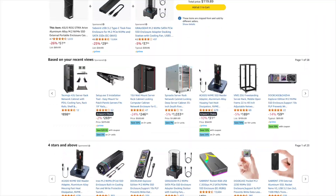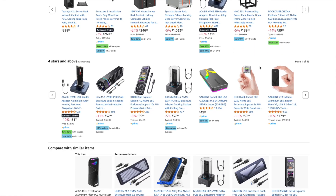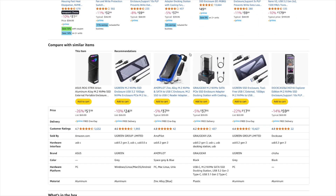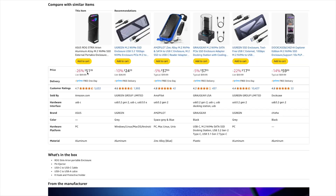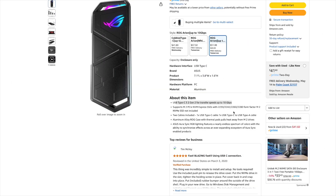You'll see looking at my Amazon that there are a lot of recommendations for NVMe just because I wanted an enclosure and got a great deal on one. It was either go with ugreen or ASUS — ASUS is a lot of money but you get what you pay for. The full transfer speed at 10 gigabits per second is going to be limited to the NVMe that's in there, and the speed of the port — you might be throttled at the port of your computer or Mac. I'm getting about 900 megabytes per second, and the WD Black is rated for much higher than that. The LED lighting is very subtle and it's sexy.